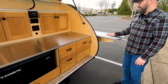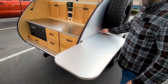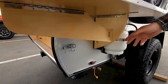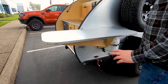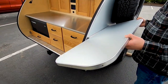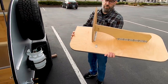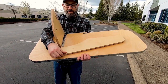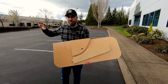On the side of the galley here is our extended side table, and I'll show you how that operates. Right now it's hung on a bracket that runs along here and supported underneath by these self-supporting braces that interlock into each other, making the table nice and solid. To detach it, you're simply going to lift up on the outside of the table and lift it off and away from the trailer. This support bracket moves out and away, that one falls, and there's a magnetic catch here to keep it flat so the braces don't flop around while you're carrying or stowing it.